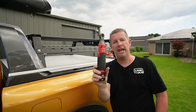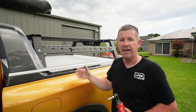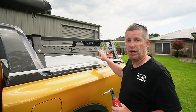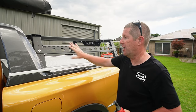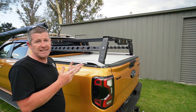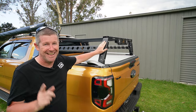To button everything up, I used my Milwaukee ratcheting socket with a number five Allen key bit on the end — that works in all the bolt heads supplied by Adventure Kings. Then behind I either had a ratcheting 13mm spanner or a socket. My theory was to pull it all in tight side-to-side and then pull it all down. So I did the sides and across the top first to get it all parallel, then went around and tightened everything else up for height and position. As a fair bit of work in this — it took me close to a day by the time I mucked around. I was actually short a whole pile of flat washers so I had to go and source some.